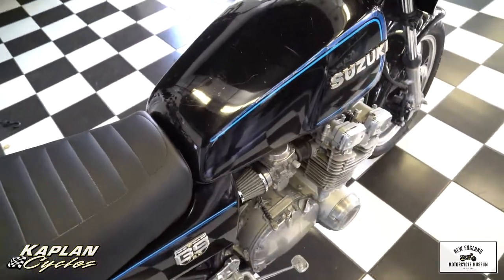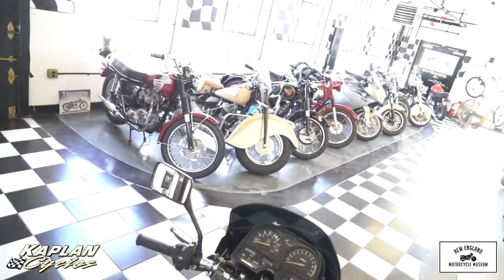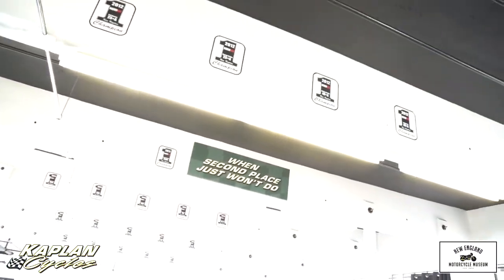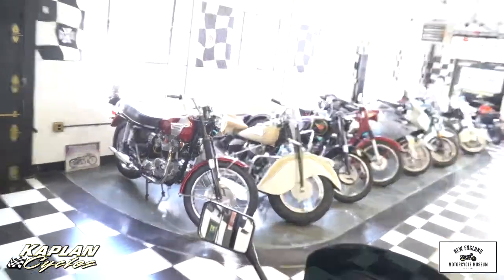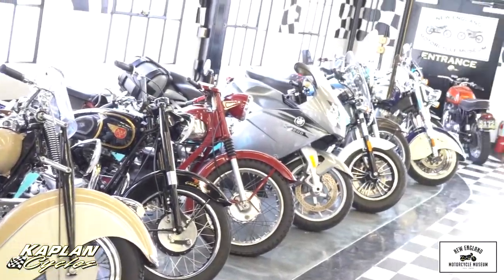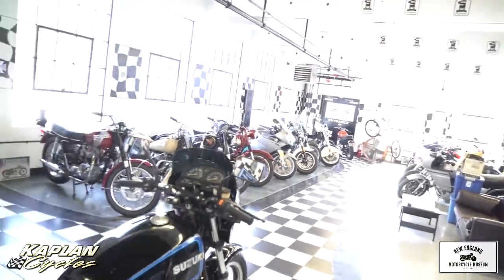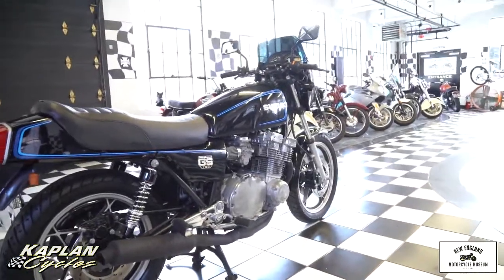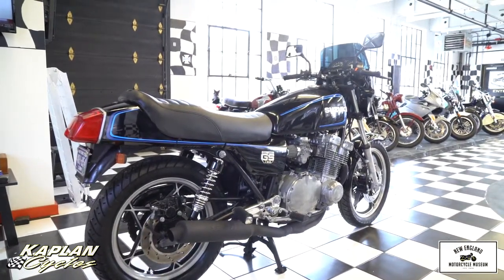brand new stepless ear clamps for the fuel lines, a 5/16 inch inline fuel filter, brand new 10 to 15 amp glass fuses, all new OEM terminals, OEM covers for the battery terminals, brand new 6 mm cable lug terminal, new front brake light switch, new petcock assembly, the entire petcock was replaced with a brand new one. Brand new reproduction tach cable by Motion Pro, so the tach cable is also brand new. Brand new 13-inch shock absorbers,